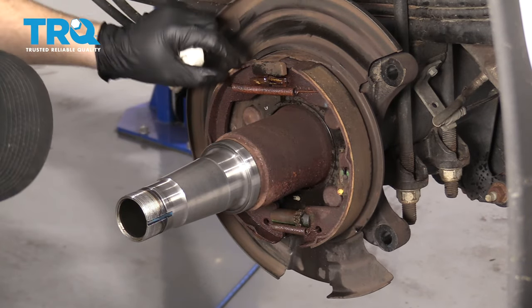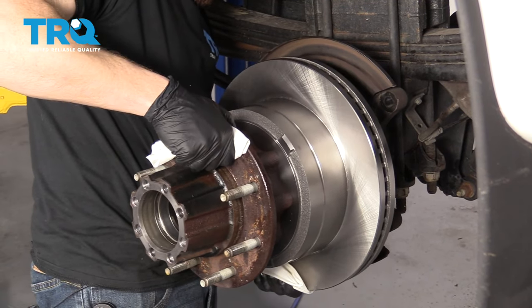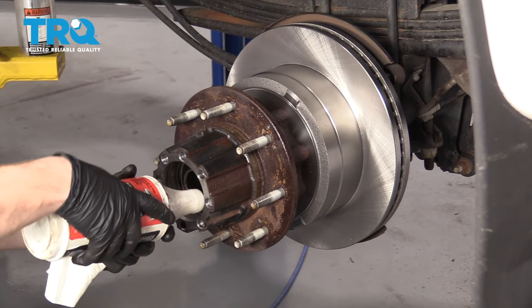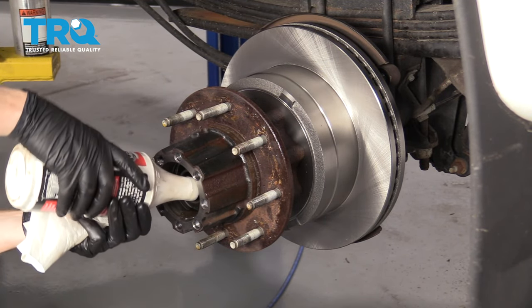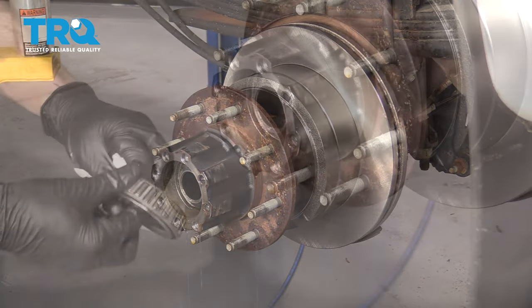It's also good for when you park. Put that in there and let it soak. Take some of your manufacturer's specified gear oil and squirt it all the way inside there — try to fill up that hub area. Nice — a little coating. Slide that in there. We know that the hub's full of gear oil; that's going to lubricate all the bearings on the inside and outside as the differential tips.